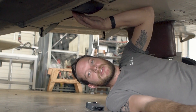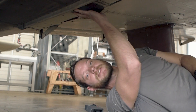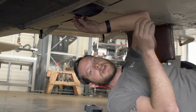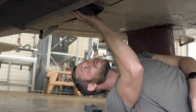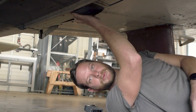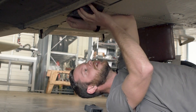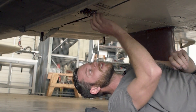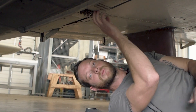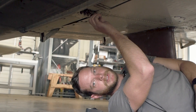One of the steps to comply with this AD is to get access to the nuts that are underneath the wing section and on the bottom of the spar. There is a plastic cover that covers all the nuts, held in with three screws and a bracket. Once you remove those three screws, you can remove the cover and get to your access point. The only ones you need to focus on in this AD are going to be your front outer two from the fuselage.